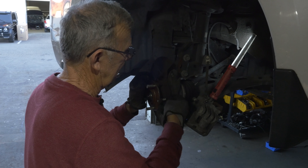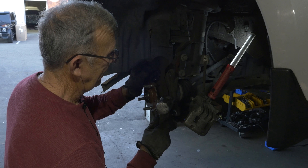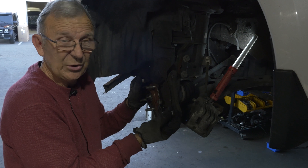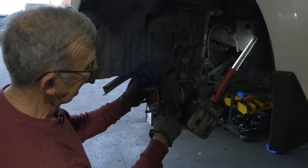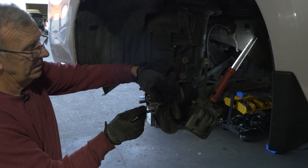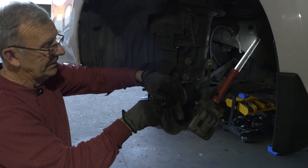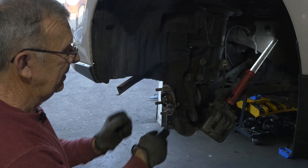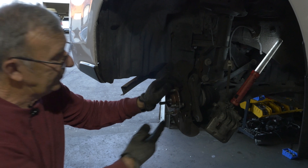The capped lug nut has a cap on it, so when you pull the stud in, you need a lug nut that contacts the stud cleanly. You stick the stud in like this. Sometimes there's a metal plate right here that you have to knock back just enough to clear and get the stud in. The broken stud was short so it came out easily, but this is a full-length stud so it hits that piece of metal — just knock it back a little bit to clear it.